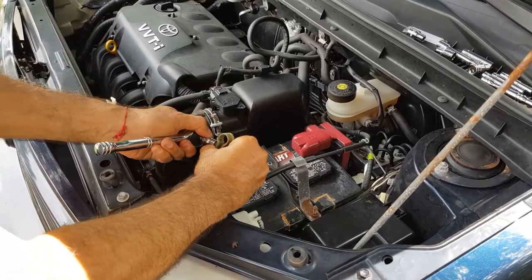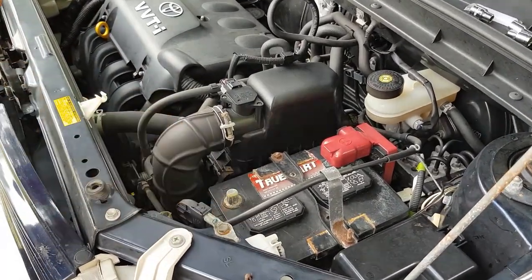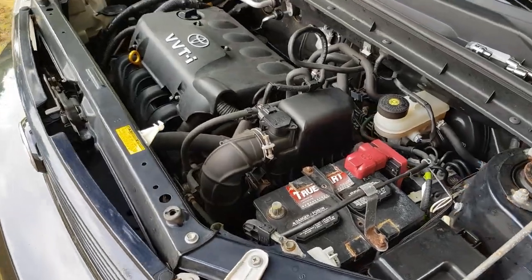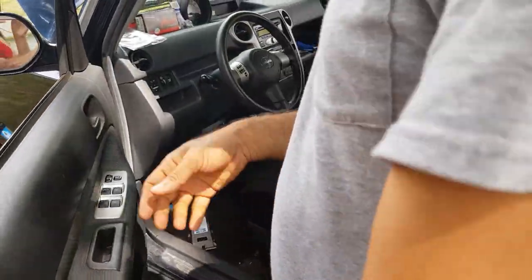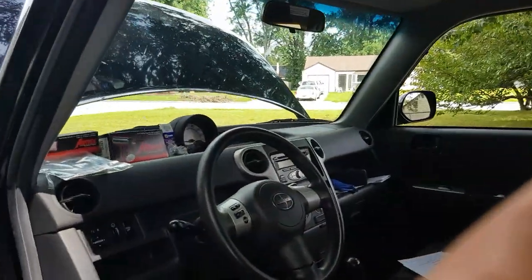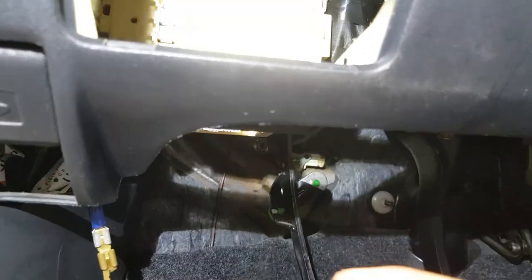Negative terminal is out — move that out of the way. We'll connect our blue relay back in so that once we have the pump installed, we'll prime it for about two or three minutes. Make sure she's well primed and then she'll have no startup problems with the new pump.